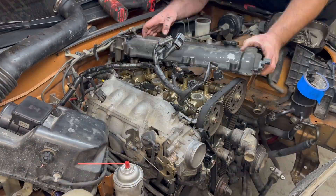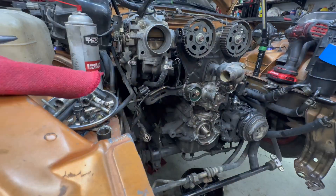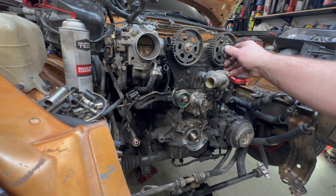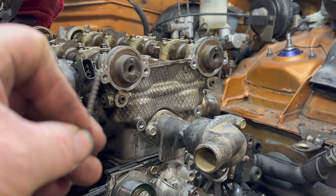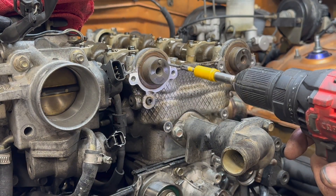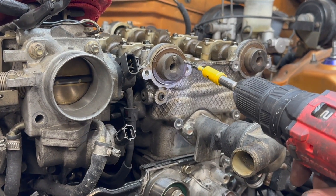Alright, let's get back to getting the valve cover off and try to get this heavy valve knocked out and get this thing fired up. So when it's straight up like that and these marks are lined up, that's the way it's supposed to be. Pop this off - I'm just doing this so I can change the seal. A trick you guys can use to get these seals out is just take a wood screw, put it through the seal, and it pulls it right out.